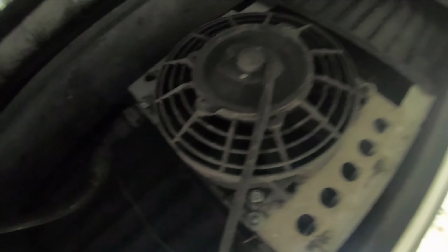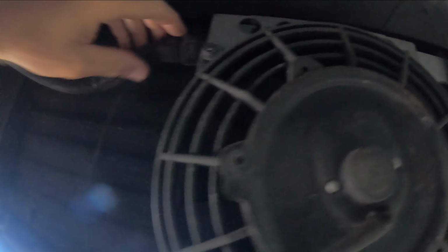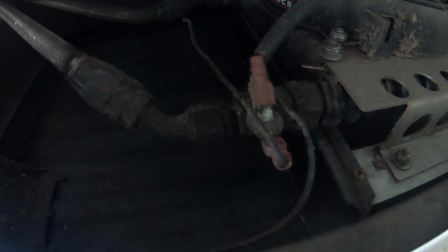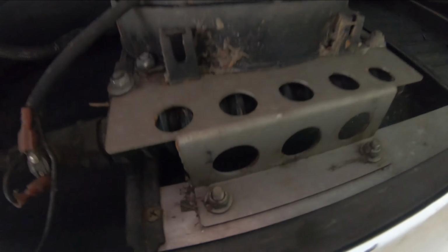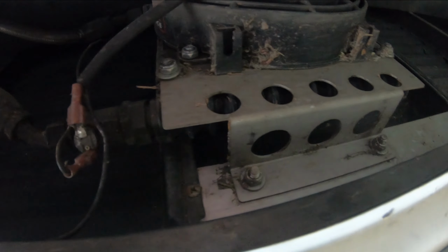So going back down over here, you can see oil lines running down here, through here, and it runs here to the external oil cooler. Now this oil cooler I mounted with some aluminum pieces here that go right into the bottom frame, and this oil cooler then has another thermostat here, which at 180 degrees turns on this fan. And here there's kind of like an air cooling thing that the oil runs sort of back and forth and back and forth, and it dumps the heat.